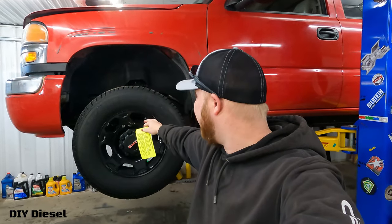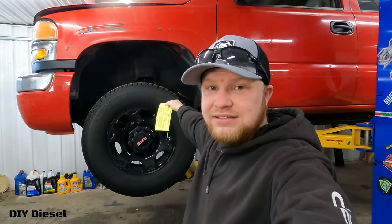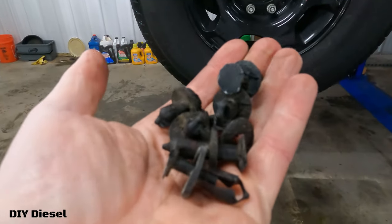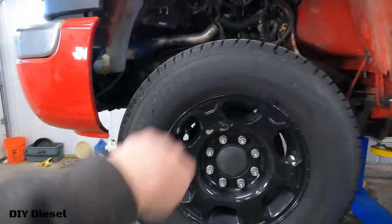The first thing we're going to do is take this tire off, take the wheel well liner off so we can get access to that side of the steering shaft and everything like that, and then we'll go up underneath the truck. Now we got our plastic — most desired, hated things I hate in the world — off of the wheel well liner.